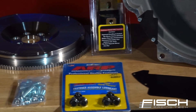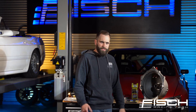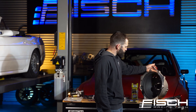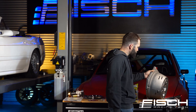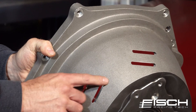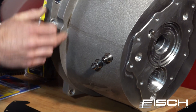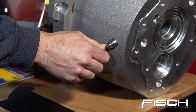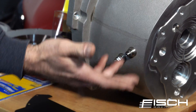We feel that this transmission is very well suited for this engine. When you purchase this kit, it comes with a one-piece casted bellhousing that is post-machined. A couple cool features to mention: it comes with some machined slots on the top for heat management. It also comes with some pass-throughs that allow you to hook up the hydraulic line fairly easily and also bleed it from outside the bellhousing.